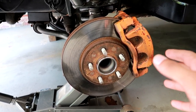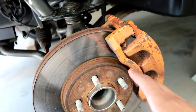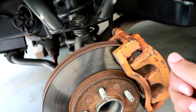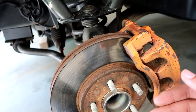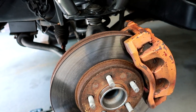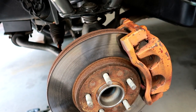There have been plenty of times that I've missed something, put everything back together, and then realized, 'Oh shoot, I forgot to tighten this bolt.' So reassure that everything you took apart and everything you touched is tight. You can hand tighten it, but I like to use a breaker bar to torque it and make sure everything is really tight — because your hand strength might not be enough for every bolt. Definitely use some kind of assistance tightening each bolt since this is dealing with your suspension and your brakes. Reinstall the rim and you should be good to go.